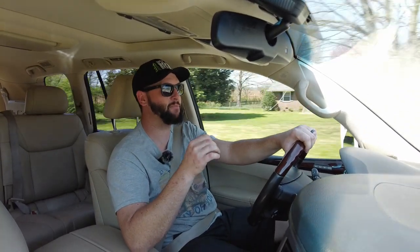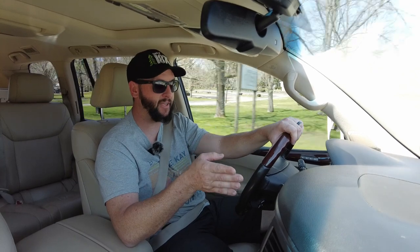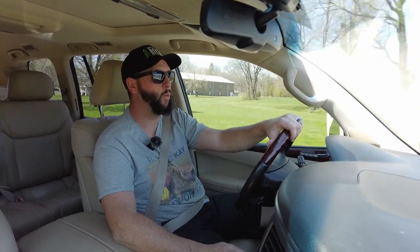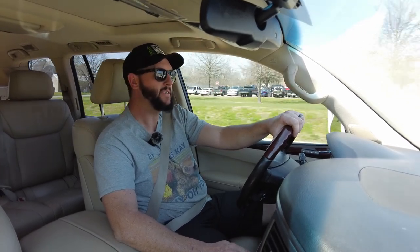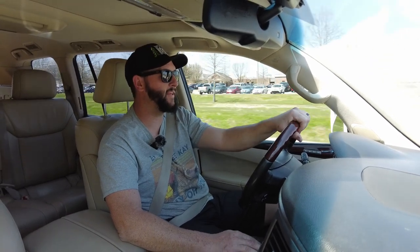So we're going to go ahead and probably go to a 17-inch Method or equivalent. We want it to be functional. I want to be able to air down and not have any issues, and that is my biggest focus. We'll probably honestly go to a 285/70 or 275/70 R17, excuse me. I think that's probably one of the best setups for this.